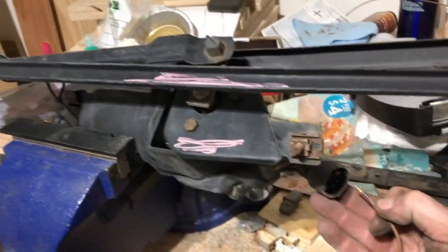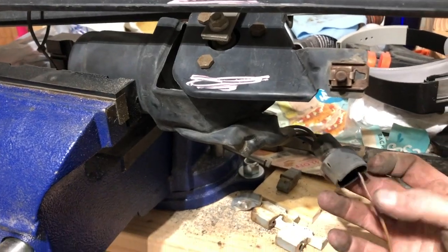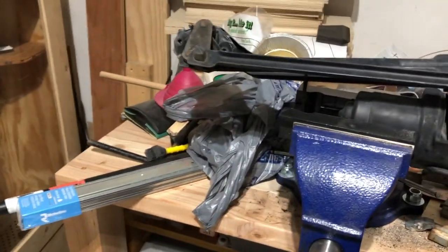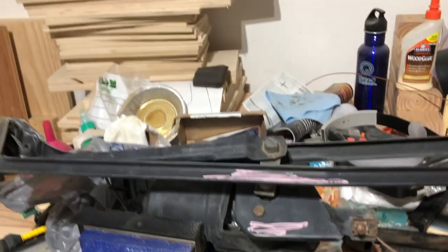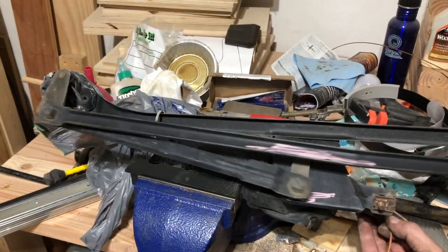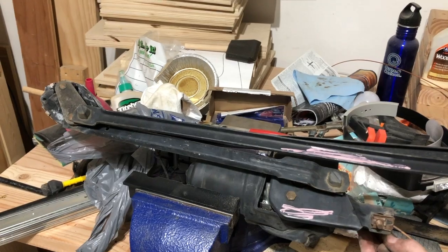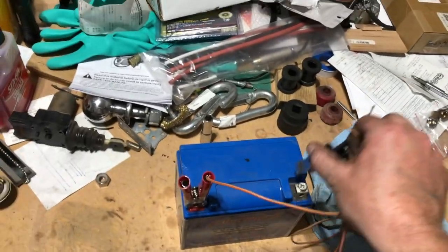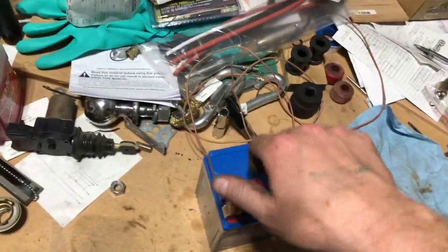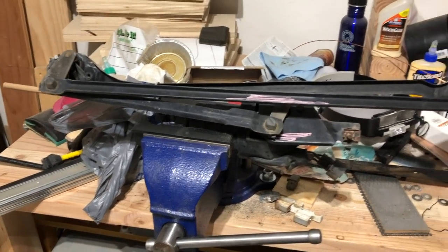Going off the color of the wires, I found the ground — the negative. I also found the high and the low. Here's the low, and you can see it spins all the way around. And here is the high. This one clearly works and seems to be working normally. Just so you know, I was hooked up to a 12-volt battery — a motorcycle battery — but it works really well for doing this kind of testing.